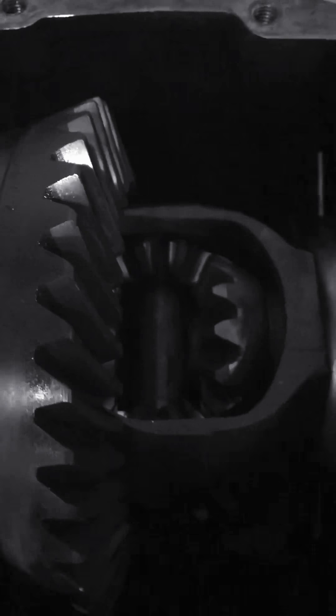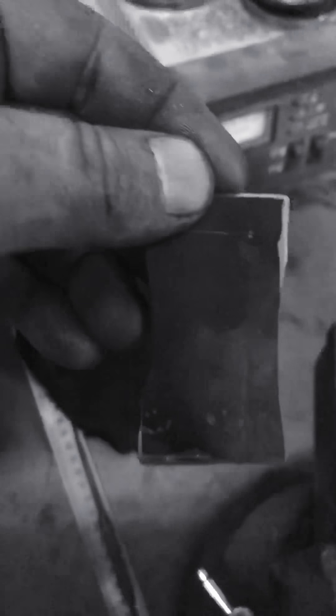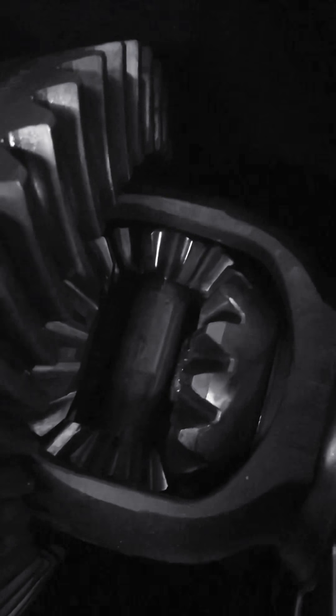It's just a cheap, quick and easy mod to go drifting. We've got some plates — 60mm by 35mm, about 3mm thick, all I had laying around. Cut them out as rectangles and chamfer the edges with a grinder to make an hourglass shape — doesn't have to be exact. They drop in nicely between the gears. First, we'll put some weld in the top corners where the planetary gears meet, tack them together as strong as we can, then drop the plates in and weld around all four planetary gears using the plate to bond them together.